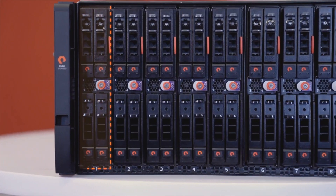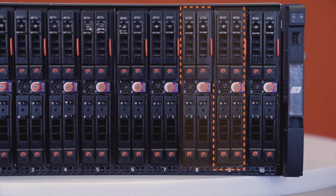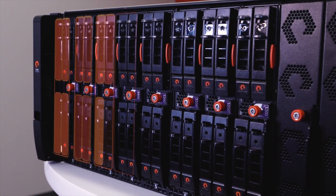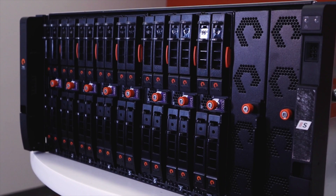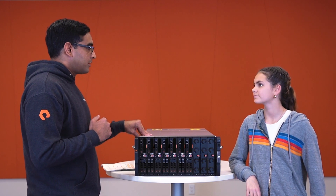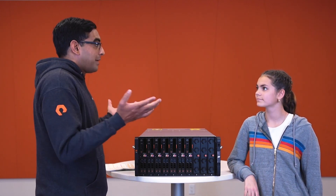We still use direct flash, but with this upgrade we have disaggregated compute and storage. Here's the all-new FlashBlade S chassis. There are now 10 blades as opposed to 15. Each blade can house one through four direct flash modules, and you can fill them with as much as 200 terabytes of raw flash at launch and add more performance via additional blades. You can independently upgrade compute and storage — if something goes wrong with a blade, you pull out your storage, swap in a new blade, stick your storage back in, and you're back up and running.